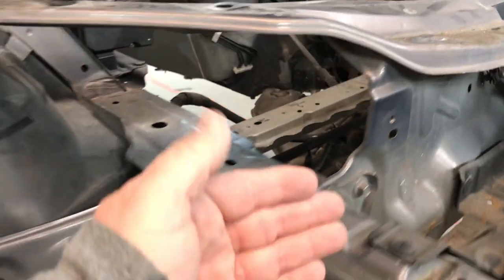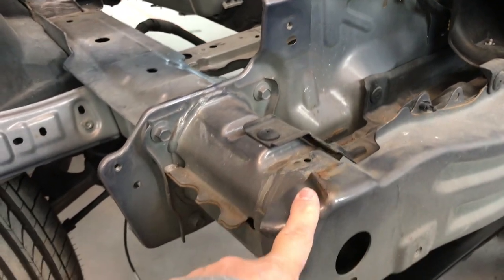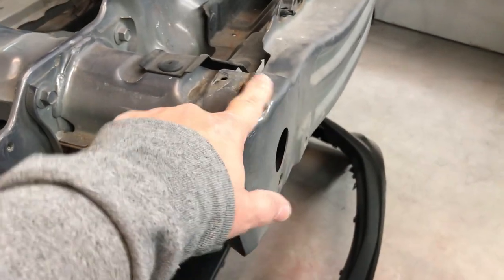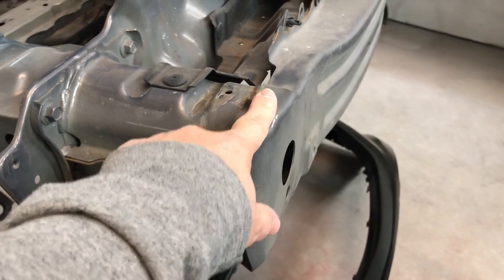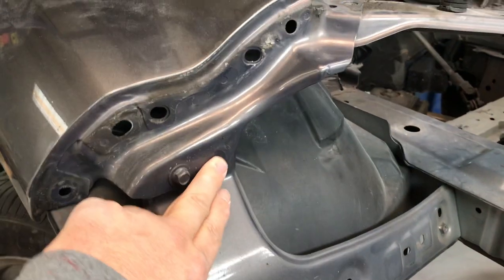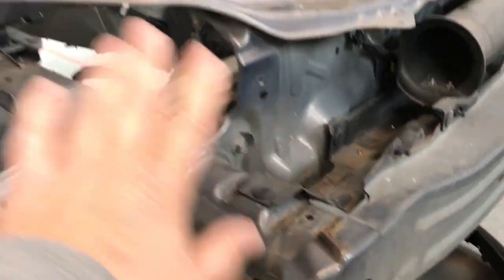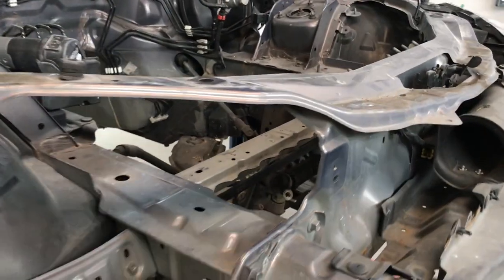The headlight didn't fit up with the bumper very well. We pulled it back apart and the reinforcement here has a slight bend to it, and I think this rise right here is holding the bumper out. Also, this piece was bent — we pulled it forward a little bit and you can see it's bent just a little bit right there. So we're going to tap that back out, make sure that's straight. We're going to bend this around and try to knock that down so the bumper will slide back, and that should alleviate the gap between our headlight and our bumper.